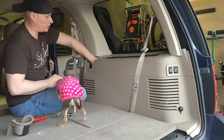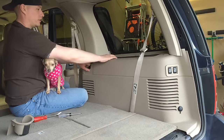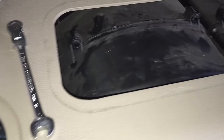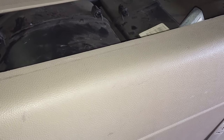At this point you can reach in here with your light and we'll be able to access it. You can see it's pulled away from the wall just a little bit and there's actually plenty of room inside. Once you have the cover off up top and the cup holder removed, we have a lot of working room without pulling anything else off. What's suggested is something like a pad or a piece of 2x4 against the case and against the interior trim cover to push it out and hold it so you have plenty of working room. Come right here in the middle, look straight down, and right there is the actuator, mounted on the side of the case.